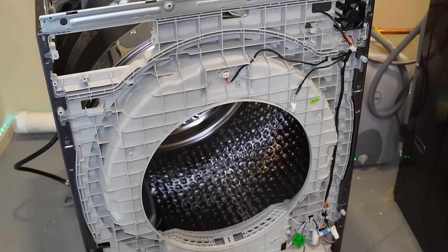With everything done, the question is: is this unit going to be reliable? Let's look at the warranty. LG has a one-year parts and labor warranty on everything, but the key is the unit does have a 10-year sealed system warranty on it — the compression system, condensers, and everything are warrantied for 10 years, which tells me LG thinks this unit is going to run for quite some time. The motor behind the unit is also warrantied for 10 years. I really like the fact that there is that direct drive motor on this — I wish every dryer had it. Not only is it reliable, there's no belt, so there's one less moving part, and it's going to be able to run forward and backward to tumble dry clothes more efficiently.